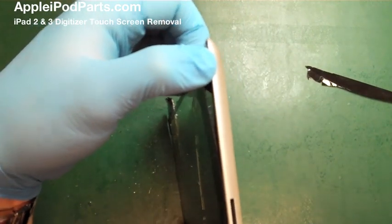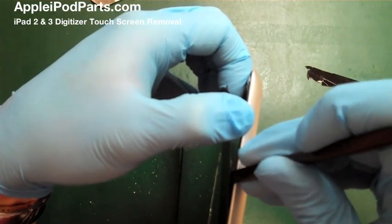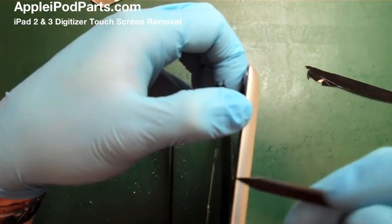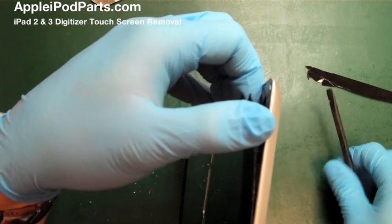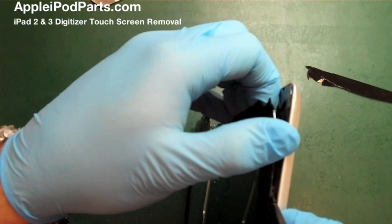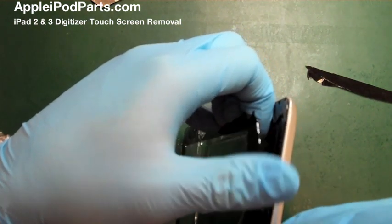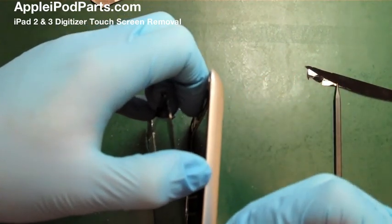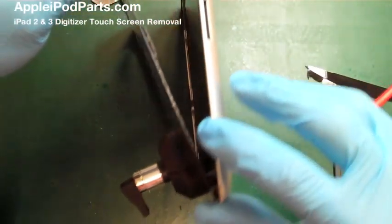As you work down here I'm about to enter an area where there's a Wi-Fi cable that is easy to break. I get just enough purchase in there, and what happens is the Wi-Fi cable sticks to the screen — as you pull the screen from the assembly the Wi-Fi cable can snap. So I pull it up enough just to see it, find a little bit of play in the Wi-Fi cable, and use the spudger just to take it off the glass and keep it stuck to the iPad.